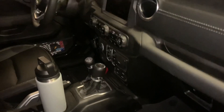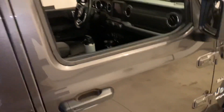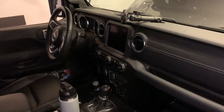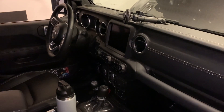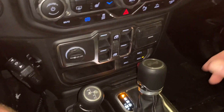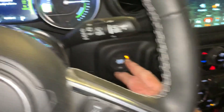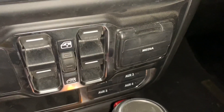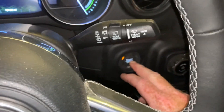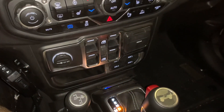Now there's an important setting to put in your Uconnect that I'll show you next. When you bypass the pedestrian warning system — what I'm calling the bypass — on the next key switch, the system will reset and the pedestrian warning system will be active again. So as you can see here, I'm going to turn on my Aux 4, which actually turns off that pedestrian warning system. I'm going to put the thing in reverse — you can see it's not working — and I'm going to put it back in park and turn the vehicle off. That switch just turned off, which re-enables the pedestrian warning system by re-enabling that normally closed loop on the relay. So next time I turn the vehicle on, the Aux switch is not on and the pedestrian warning system operates again.